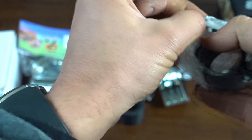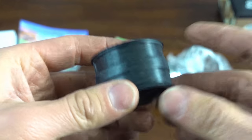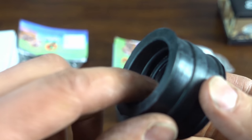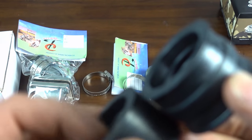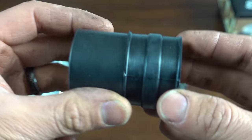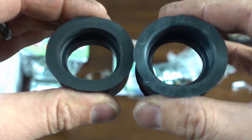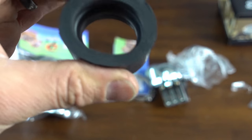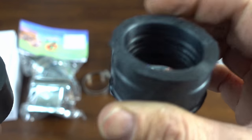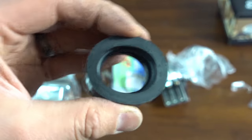We're going to pull a Polini boot out — this is a Polini boot, and you can put it on these CT manifolds. If you run a CT, this is a really good option. You can see this thing is much, much softer and much more pliable. The other thing is the lip that holds your carburetor in there is definitely deeper and thicker and more robust than the Goofit. Also, it's got two spots where your hose clamps fit in place so they're not walking all over the place. It's definitely nicer quality.